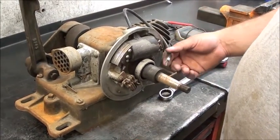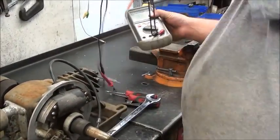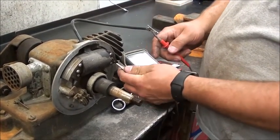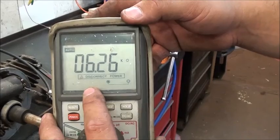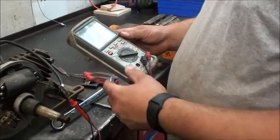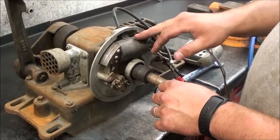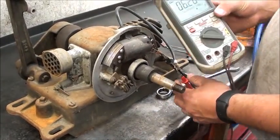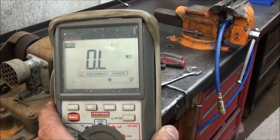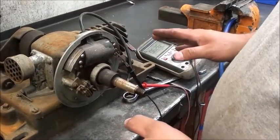The next thing to do is check the coil. There are two sides of the coil to check. We're going to take our standard digital multimeter and check from the plug wire to ground. Anywhere on the motor is fine — I like to go right on the laminates. We have 6.26K, or 6,260 ohms. That's a good coil. You may notice several different readings depending on the exact coil — Maytag changed them a little bit over the years — but the idea is that we have continuity. If the meter shows OL, meaning open line, that's a defective coil. As a rule of thumb, if you show continuity the coil is good; if it shows open, it's bad.